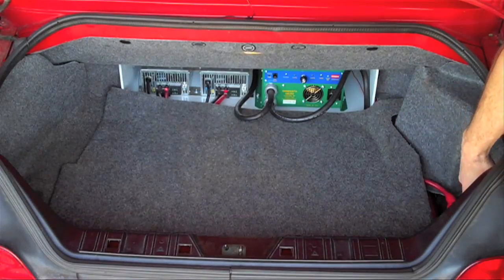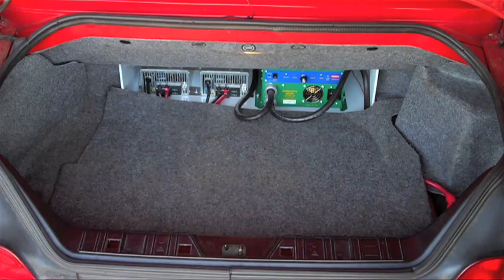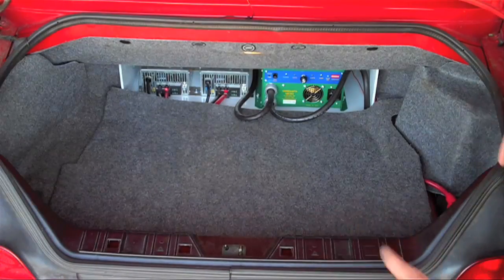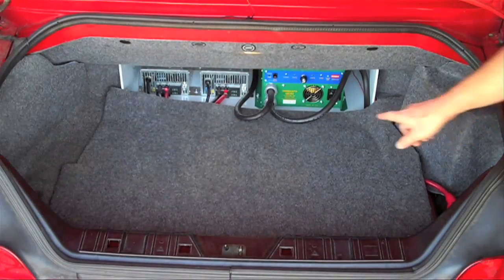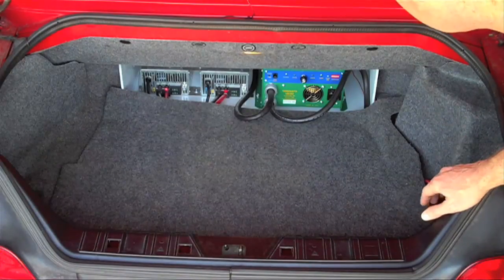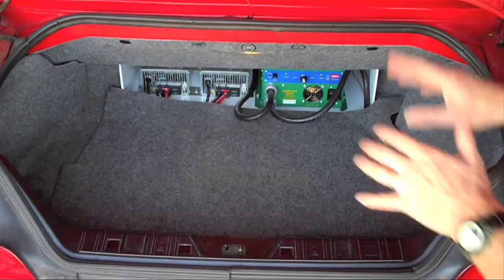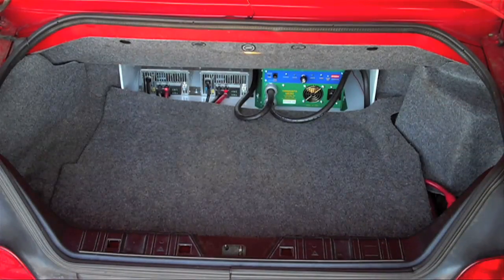That was important to the system to make sure that the 12 volt system is adequately charged. In addition to that I also have a lead acid battery over here — it's one of the gel kind of batteries. It's quite small, and in the event that the main pack dies and those two aren't providing any power, I have this little 12 volt battery that can provide power for the hazards or whatever else is necessary. The other component in the box is just the charger. I decided to mount the charger in the car so that I could charge the car wherever I go. Some people will choose to leave it out of the car to save on weight or space, but I elected to have it in there so wherever I go I can charge up if I need to.